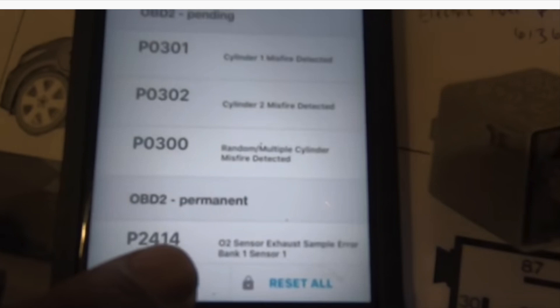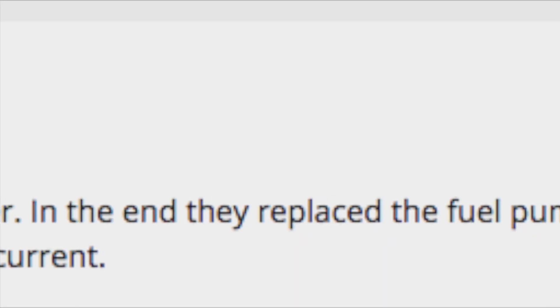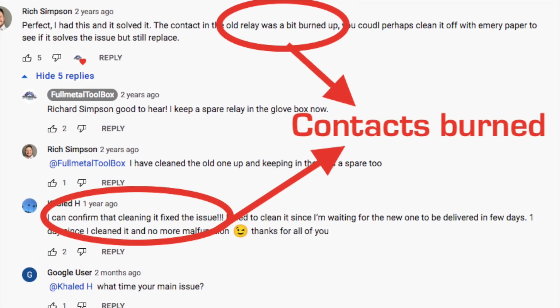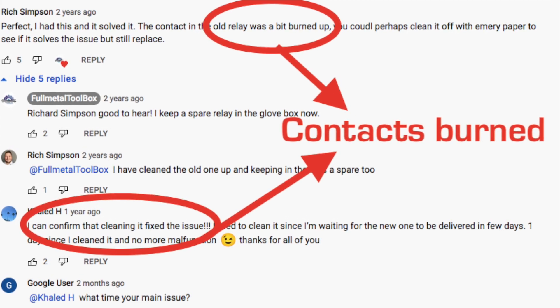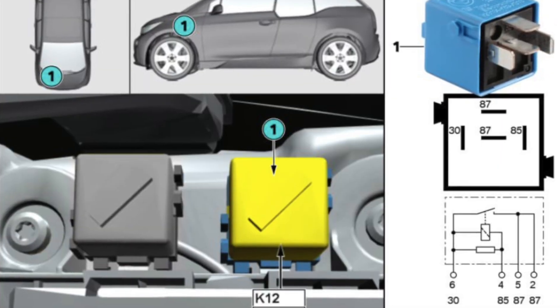This has happened on many cars in many forums. People have recorded it. There's one comment that mentioned about 40,000 miles and REX being fairly well used, and it was finally fixed by replacing the fuel pump relay. Whether that's common or not is hard to say. The contacts in the relay appear to get burned, based on several comments from people who have taken it apart and looked at it — so that is one piece of information that suggests what the failure mode is. It's really difficult to get to that relay, but there are comments of people saying it's been repaired by doing that.